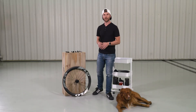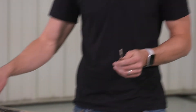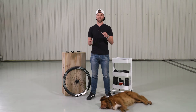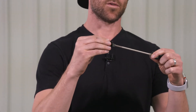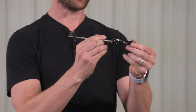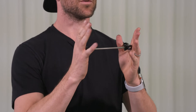There are multiple attachment styles for attaching a wheel to a frame. The most traditional you're going to see is something called a quick-release skewer. A quick-release skewer works on compression. There are a few parts — the end piece here has a compression spring on both sides, and when threaded in place through your hub, you tighten this lever and it allows you to squeeze the wheel onto the frame.